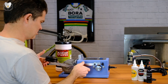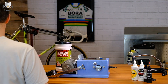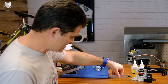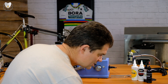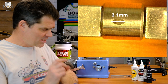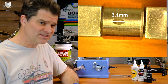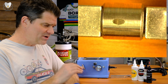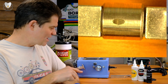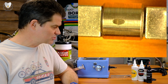Timer is done. Let's stop and pull it out. You can see we've got a good bit of flinging going on there. I'd actually say that is better than I expected — not amazing, but better than expected. Let's put it down there and get it in the video. We'll get a picture taken of that. Look at that — that's probably about a 2.5 to 3-millimeter scar. That's actually quite a bit better than a lot of the older technology lubes we test on this machine. So ProGold standard chain lube — not bad. For a lube that we know is not super low friction, we're probably talking about 3 to 4 watts off the Synergetic, but from a wear tribology perspective I would put it probably in the top 20% of ones that we've seen. Interesting result. Nice job, ProLink.